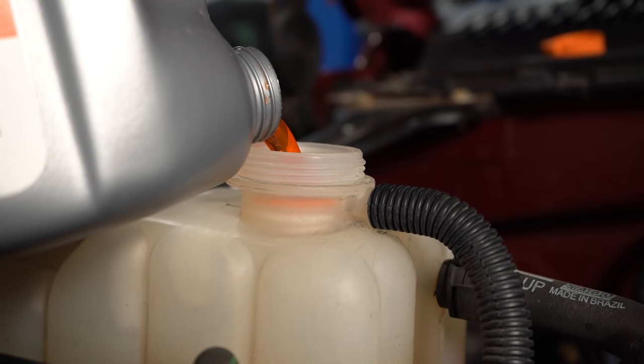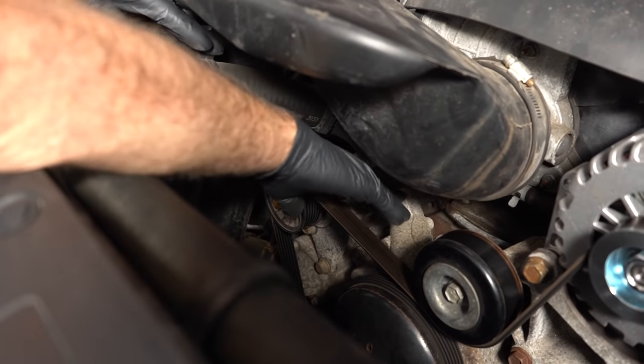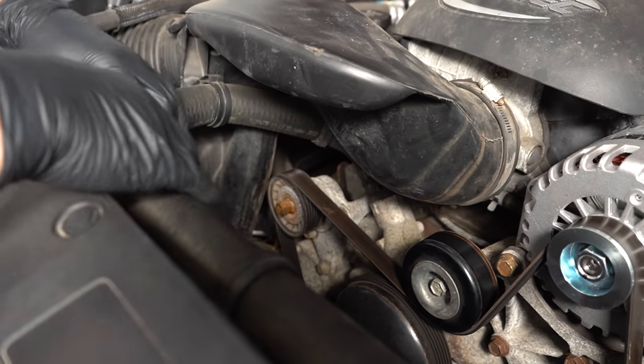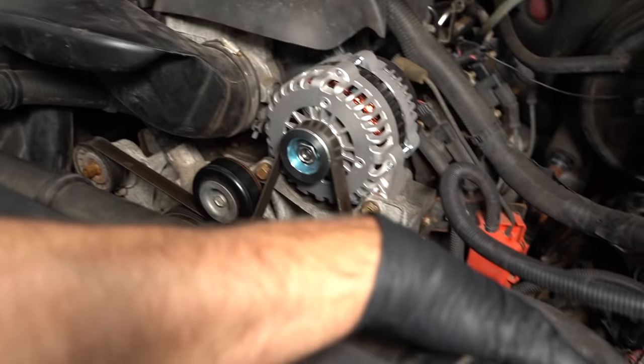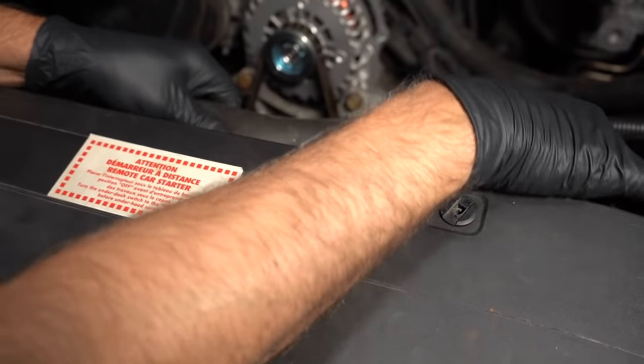Just make sure you have the correct 50-50 mix. After I'm done with my repair and I'm adding coolant to the system, the coolant level is coming up, there's air on the top and it's pressurizing — it's got nowhere to go. For this vehicle, as the air is coming up and the coolant level is rising, there's going to be an air pocket right here that's going to come over to the radiator. You can actually squeeze the hose a little bit to try to get some of the air pocket out.